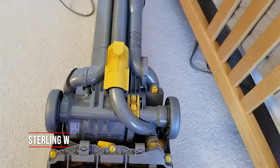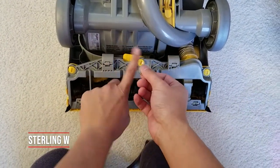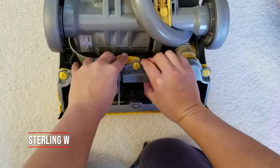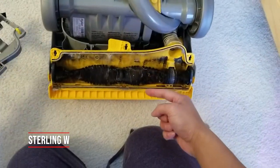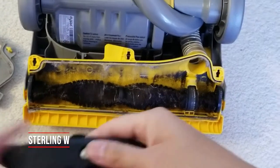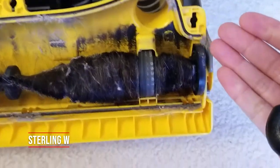A simple coin does that. If we take a look at this, they're all standing straight up instead of horizontal. With that we could go ahead and slowly lift this thing off. And look at that dust — there's even other dust caught in other crevices. So this huge roller brush rotates and we need a utility knife to basically start cutting all this hair buildup.